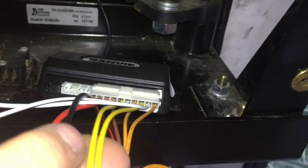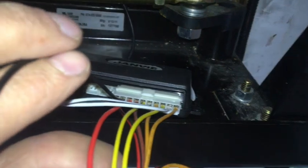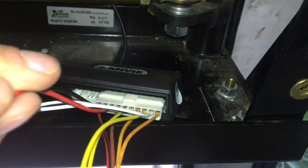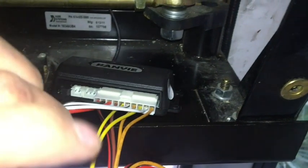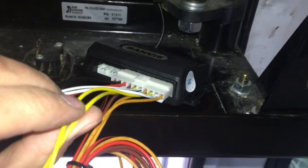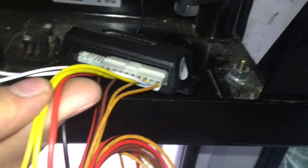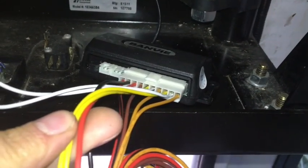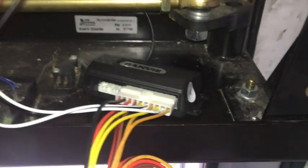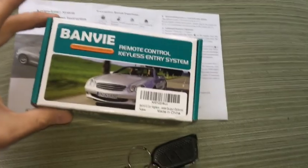For the actual power we use the other four wires: two yellows and a black and a red. The black is the ground that goes to the negative terminal on the 12-volt battery. The red is the positive that goes to the positive terminal on the 12-volt battery. These two yellows were also labeled power, so we spliced them in with the red — so red and two yellows all go to the positive terminal on the 12-volt battery, and black goes to negative.